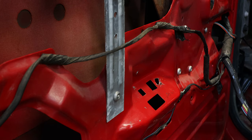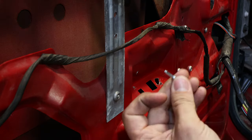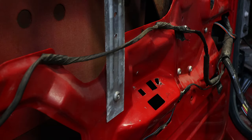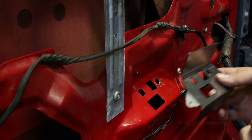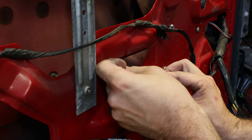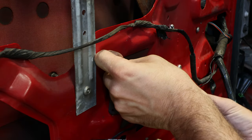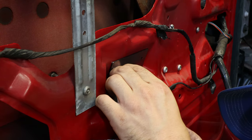The bit size you're going to want is a 1/8 inch drill bit — that's the perfect size for the end of this pop rivet. I just drilled these two holes here and basically I'm going to put this up and use those two holes to align the actual bracket. I'll drill the other holes once these two are riveted in place, that way we make sure we don't get the holes off.